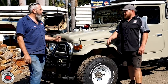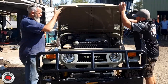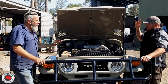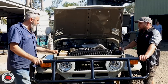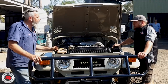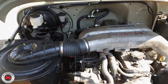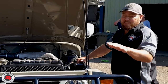Let's look under the bonnet. There's the new power plant — a 12HT. Because he's a tradie going to be pulling all his tools in a tradie trailer, the old H-motor wasn't enough. This thing is going to be absolutely perfect for what he's going to put it through. It's not just the engine — the customer supplied the engine. There's a five-speed gearbox, and while we're at it, power steering from a 60 series — we've plumbed that in. Let's not forget disc brakes: we've got the 80 series booster and 80 series master. With his trailer brakes and the disc brakes on the front, it's just going to be perfect.